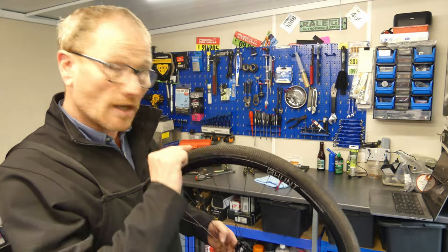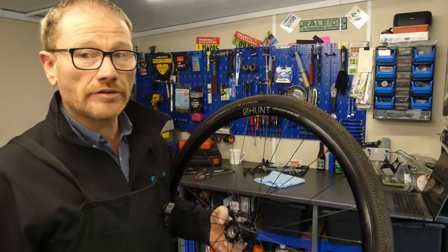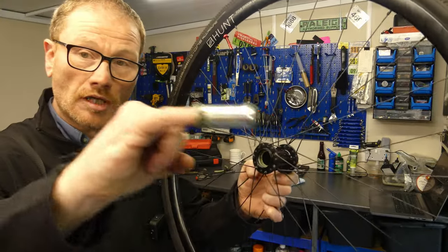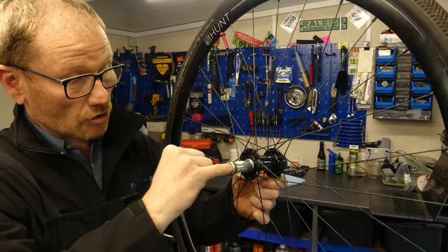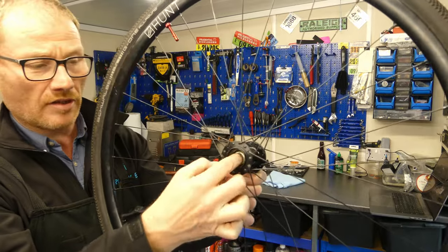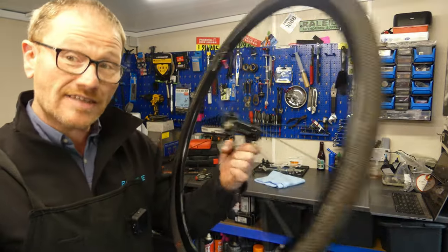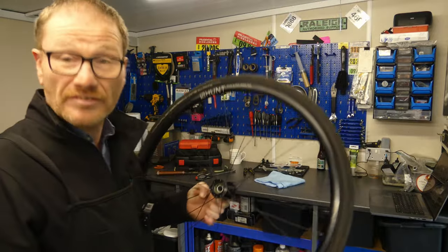Getting the preload tube and nudging it to one side. No. Let's pretend I tapped this bearing out and didn't use a puller. Now let's have a look at that preload tube, and you will see there's a lot more to it. And that preload tube fits snugly inside that hub and doesn't move from side to side. So you're not nudging it to one side. So you can't just tap the bearings out of this hub with a screwdriver. It's not possible. So let's try it on a different hub.